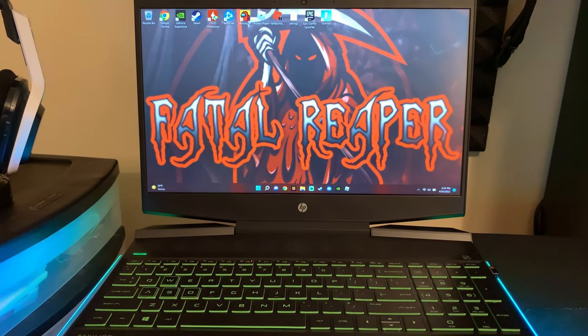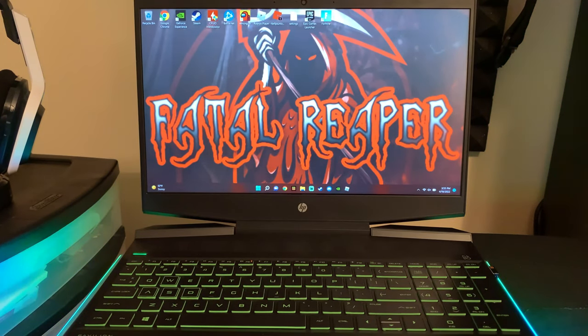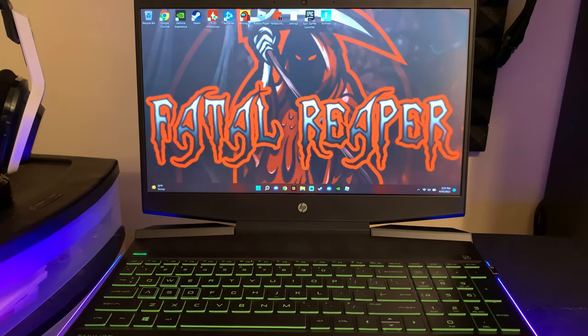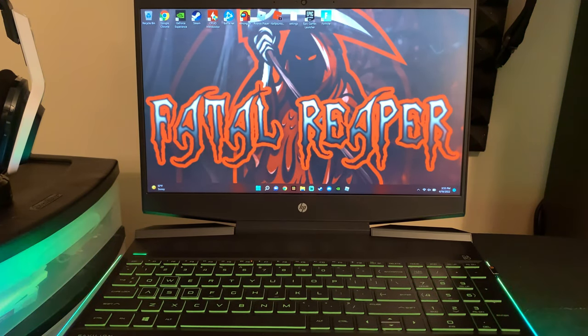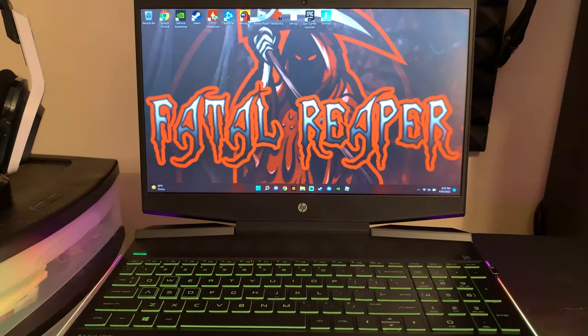Keep your drivers up to date, update your computer, and run cleanup software to remove junk files — extra files you don't need. I do that on my main PC as well. It's also good to do a hard drive wipe every couple of years: wipe the whole drive, take everything off, reinstall, and save your files to an external hard drive or thumb drive first. That can be time-consuming, especially without good internet, but it's really good to do periodically to prolong your laptop's lifespan.